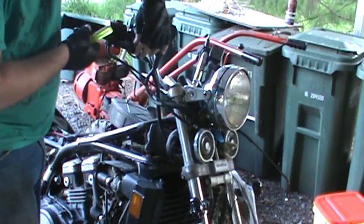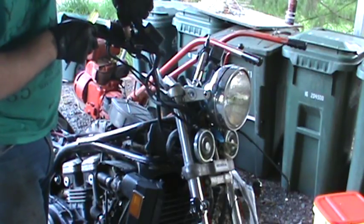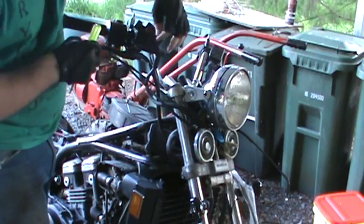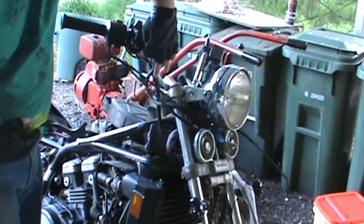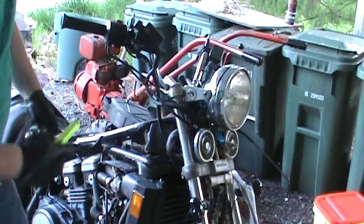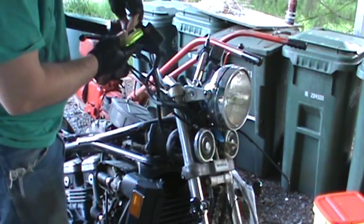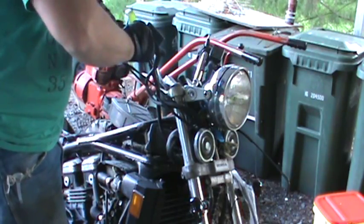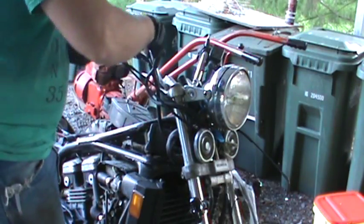It literally just slides in there. You got to make sure that when you push it in, the plunger hits here, back on the back. This part hits the plunger that actually depresses your brake. And then on the front, the plate that's here should hit this little electrical signal right there to turn your brake lights on and off. So slide that right in there. Slide that down through the top, kind of wiggle it in, move around a little bit for you.